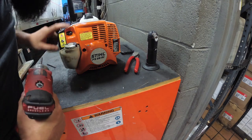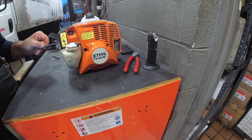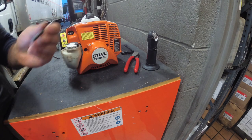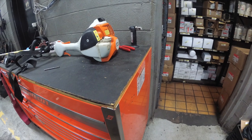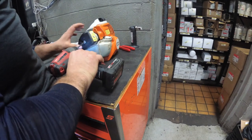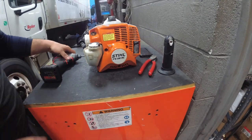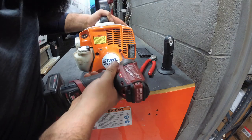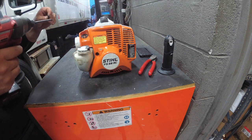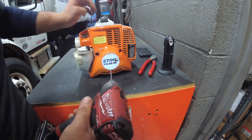Keyword: looks. And this looks like it overlaps. Yes, let's take off the air filter cover. That's obviously smaller. The air filter cover housing is a T25, so that's right here. Zip this off. Air filter. And then over here, you have your high and low adjustment screws and then your idle. But since this thing runs amazing, we don't need to touch those. See here? See how this covered all that? Oh, I'm sorry. So everything is a T. What did I say? It's T25. The funny part is that fit in before.